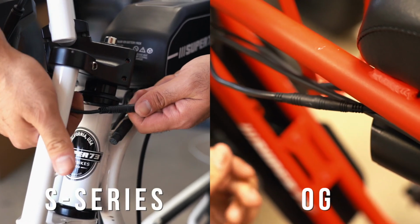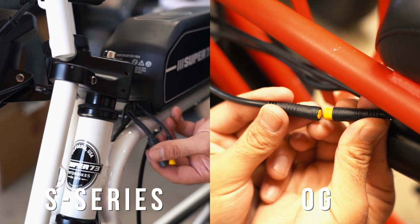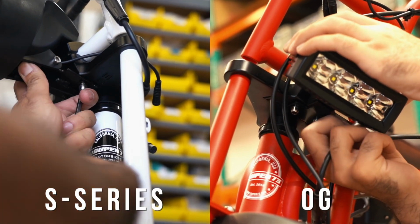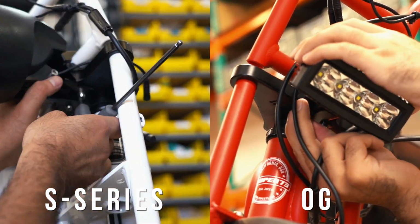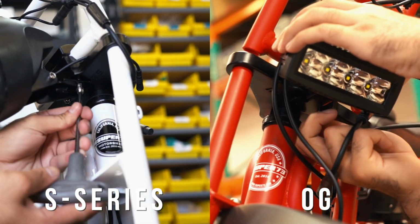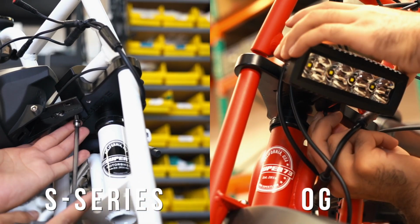The headlight removal may vary per model. Please disregard any headlight instructions for the Z1 model. For the S1 model, disconnect the plug from the headlight to the controller by pulling the male and female connectors straight away from each other. Remove the headlight by removing the 2 screws that hold the bracket onto the underside of the top crown. Keep the current headlight bracket on the headlight for reinstallation on the suspension fork.